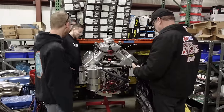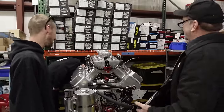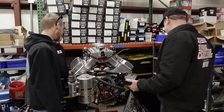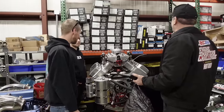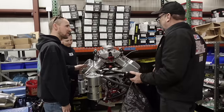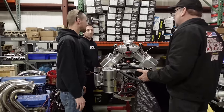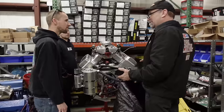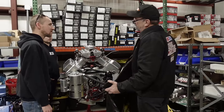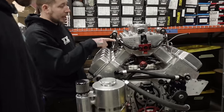It kind of looks like a 700 cubic inch engine. It doesn't look that much different than ours. What's the deck height on this? You think it looks bigger? Definitely. I think it's a 12.3. Was ours 11.2? I think ours was 11.2. That other block you got here is like 11.7 — no, that was a 12-inch deck. That motor could be made bigger; that block could be made over 800 cubic inches. So you could have a completely new intake.